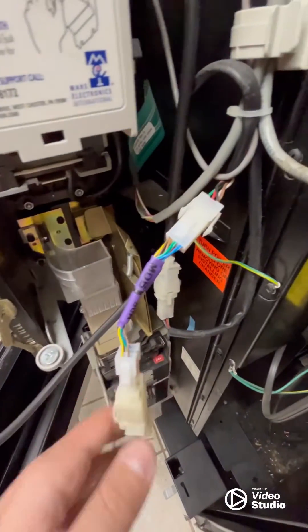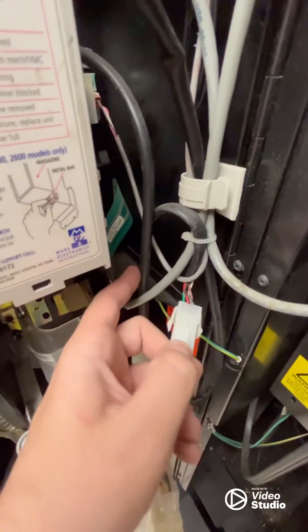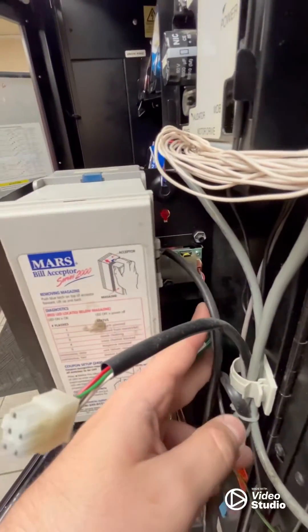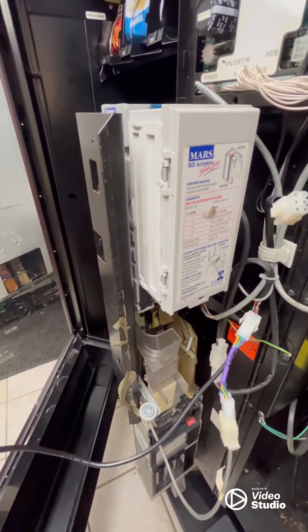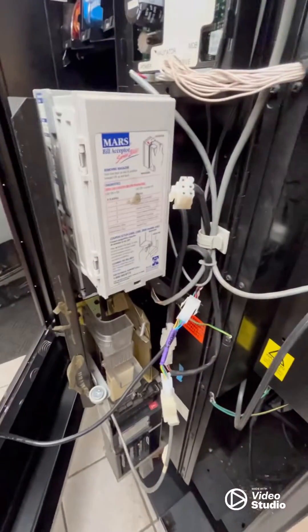We're going to follow our last cord coming out of here — this is what's connecting to the actual machine. The easiest way to do this so you don't start mixing up ports: go ahead and find your coin mech, follow the coin mech up, and that's going to plug into this wire here which leads right back to there. Then follow that up to the next wire, trace that down, and watch it walk right up into our bill acceptor. We are completely connected. We're going to organize these cords with our zip ties and twist ties and power this thing on.